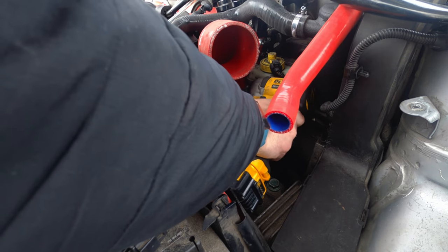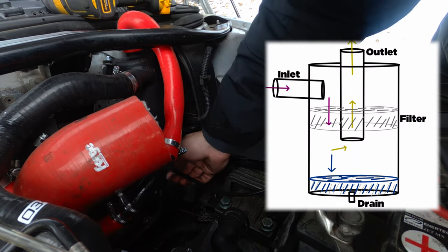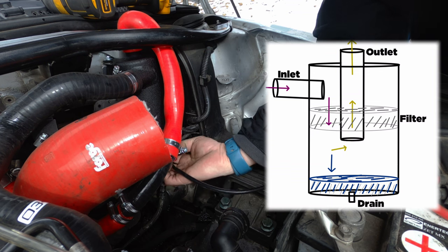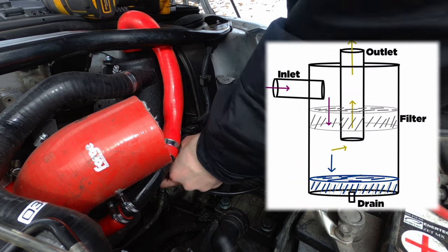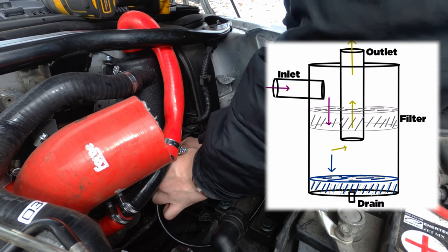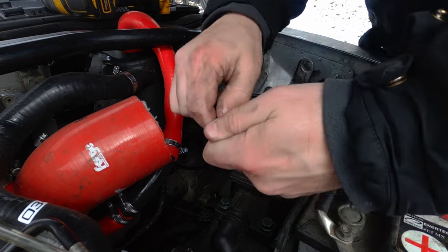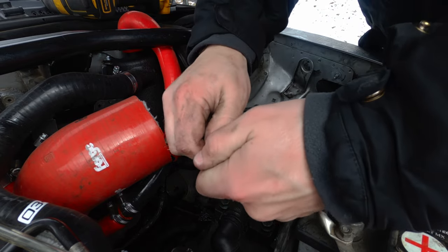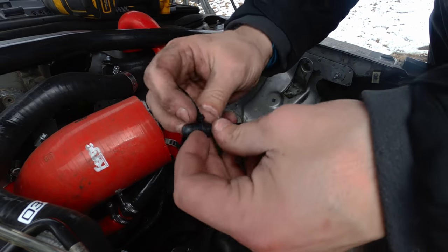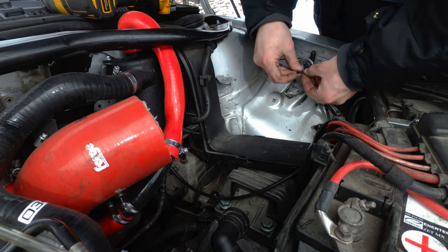This catch can is effectively just a gravity chamber on the inside. The air-oil mixture enters through the side and is met with the wall of a chamber. Due to gravity it all falls down the can. The outlet is on the top — solids don't exactly float upwards, but air has no problem. So the oil is effectively caught and the air is allowed to go straight up back through the intake, meaning we won't have pressure buildup. The only thing still up for debate is whether the pressure relief valve has a purpose in this system.